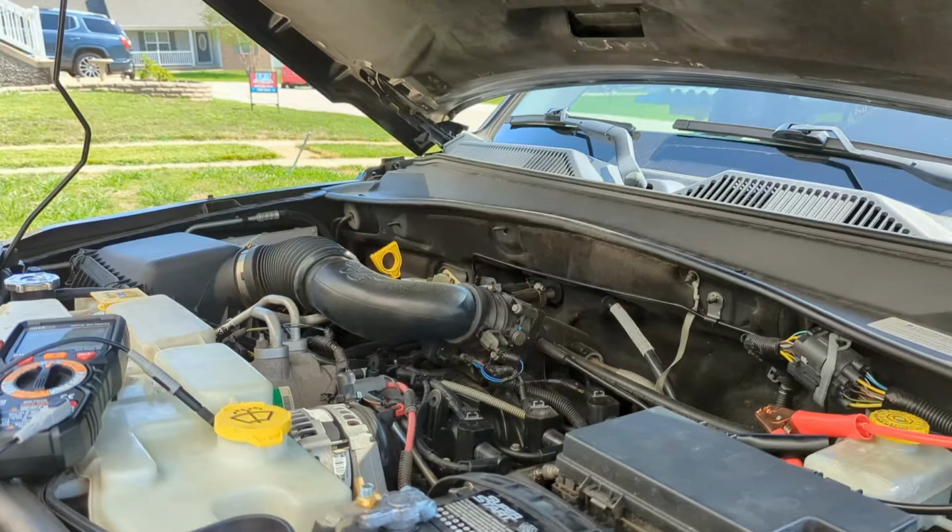They stay on, like your computer. Your PCM stays on for about 5 minutes or so, and it draws current. So you have to get to the state where it shuts off, and then there are other things that may be manifesting themselves as problems that you won't see if you don't do it the way I'm about to show you how to do it. So let's get underneath the hood and I'll take you through it.